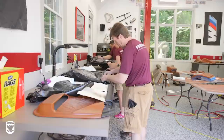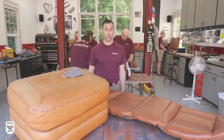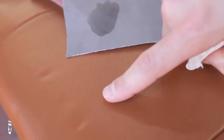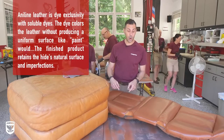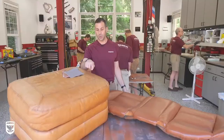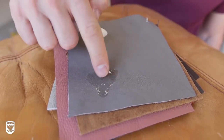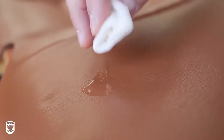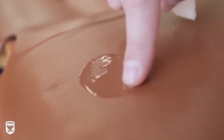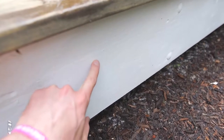The next day, I asked Brian to summarize the most common types of leather and how to tell the difference between them. A lot of people think that leather is leather, but that isn't necessarily the case. In the wild you generally see two types: aniline leather and fully finished leather. In your car you most likely have fully finished, but some vehicles like the Ford King Ranch do have aniline leather. There's a very easy way to tell the difference — a water test. The water soaks into aniline leather but does not on fully finished. Think of it like a deck: you can stain it to see the grain — that's aniline — or paint it a solid color — that's fully finished leather.